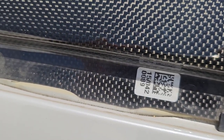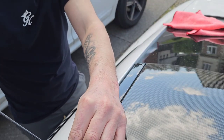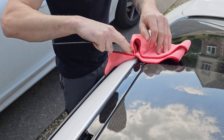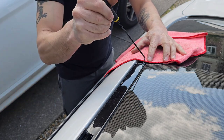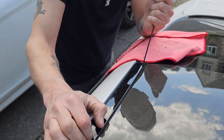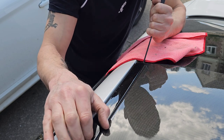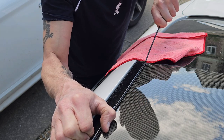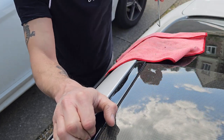Right, I'll get you set up and then we'll start with the process. All I'm doing here is pulling up this little access for the roof rack itself. Try to be careful you don't scratch your car. I'm using a little right-angled hook - I can get that underneath, angle it, it's just going to allow me to pull a little bit. We're pulling the trim towards the back of the car. This piece will hit the window, so you lift that up a little bit and then continue pulling.